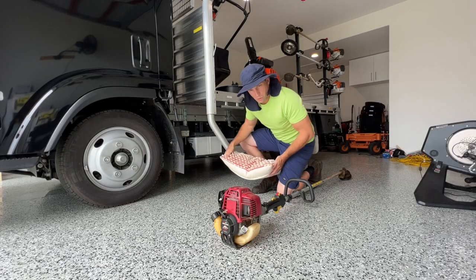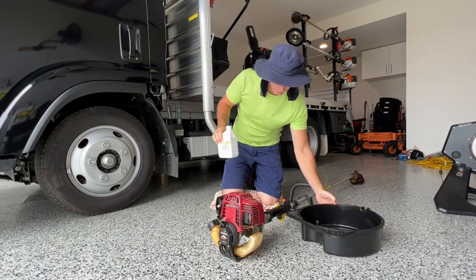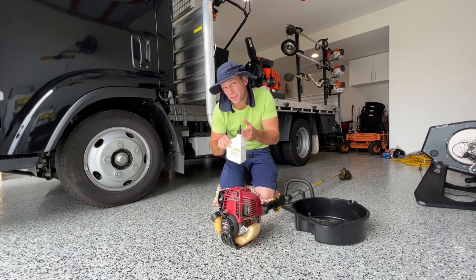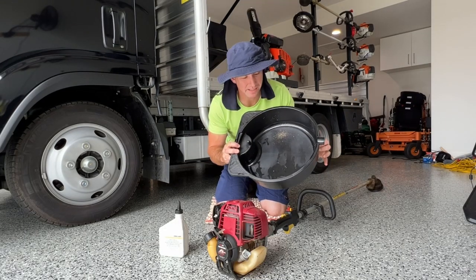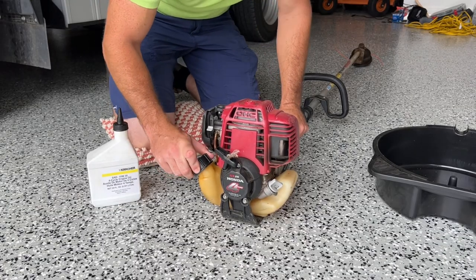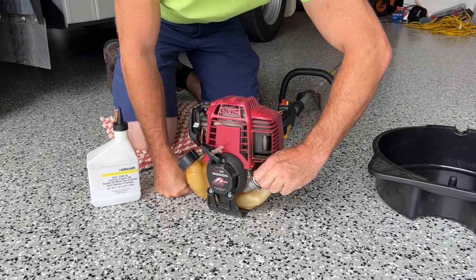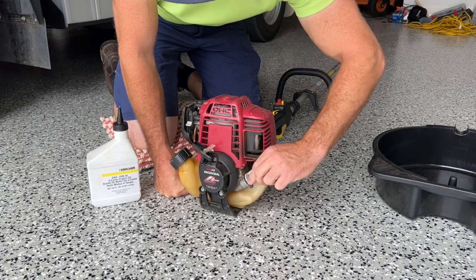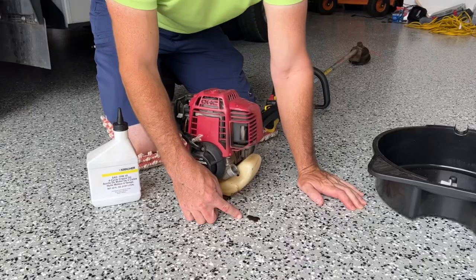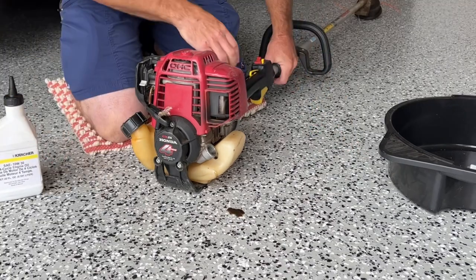The first thing we're going to do is lay out all our items. I'm using 10W30 oil here — try and get something that's easy to pour with. You don't have to have an oil pan, just any container that you can tip the oil into. Make sure you check the fuel cap is completely done up — the last thing you want is fuel going everywhere. Now for the Honda, the oil inlet and outlet is right here. Just unscrew that. You can see the colour of this oil — definitely due for a change. Very easy to get the oil out of the engine — simply tip it.